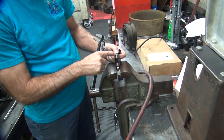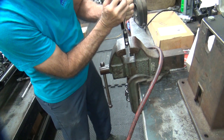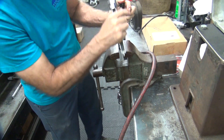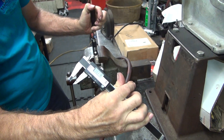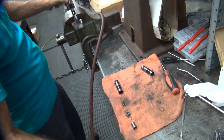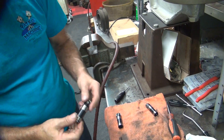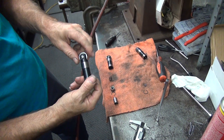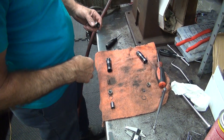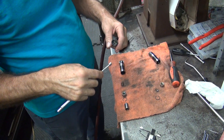I checked to see what the depth is, bottomed out inside the lifter. This one has all the guts in it — now roughly 319. Which one? It's more like 312 to 315. This is a number 10 lifter, smooth inside, the piston moving good. Everything's good now that the muck came out of it. It seemed clean but it had to burnish itself in.